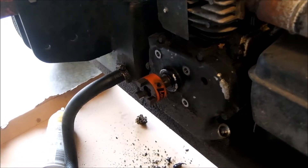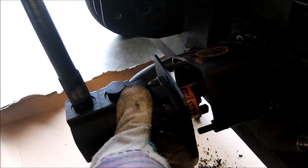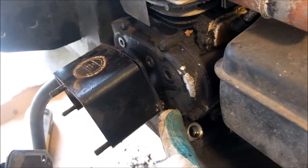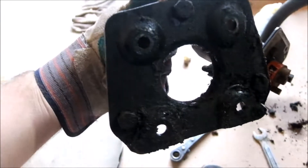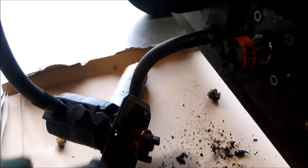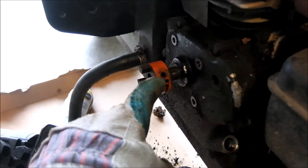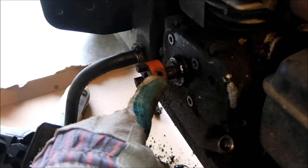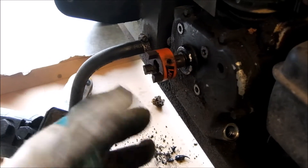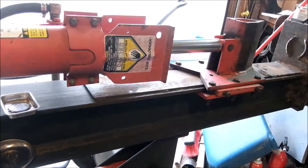The mounting spots should be the same, the shaft should be close — might be longer. The crazy part is how this was mounted up to this adapter plate — you had to hold the bolts in here. There are bolts inside this cover which connect to your classic Lovejoy coupler. Hopefully that does not strip out. I'm waiting for the other engine to come — a hundred dollars, a lot better than a thousand-dollar log splitter.